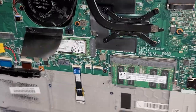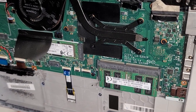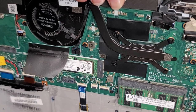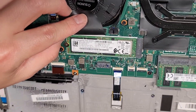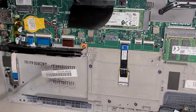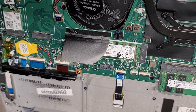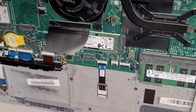The CPU is soldered to the motherboard and it's integrated, and the GPU is integrated in it as well. So don't ask if the CPU or GPU can be replaced — if you're able to do it, you'd already know, because it needs special tools and lots of knowledge and skills. You'd need to buy another compatible motherboard to swap out. You've got this PCIe NVMe SSD held by one screw — pull it up slightly and then pull it back and it should come out. If you're going to replace it, keep in mind the operating system is on there, so you won't have Windows if you swap the drive and your computer won't boot.